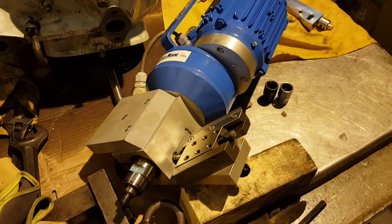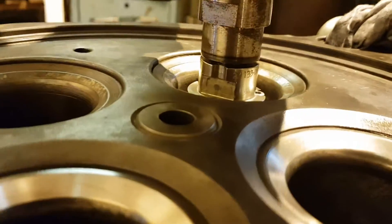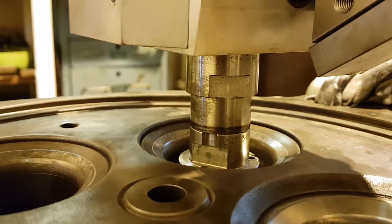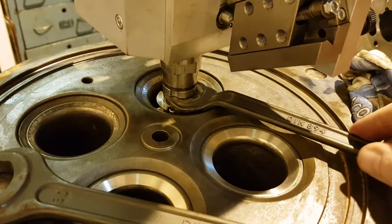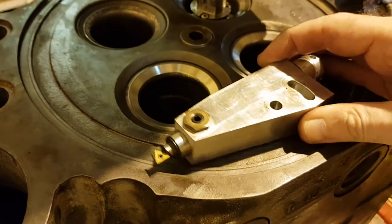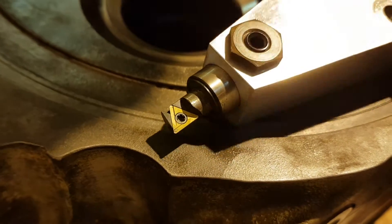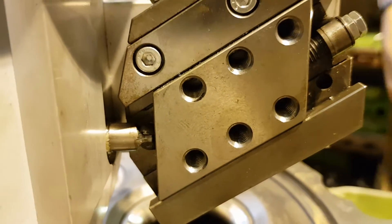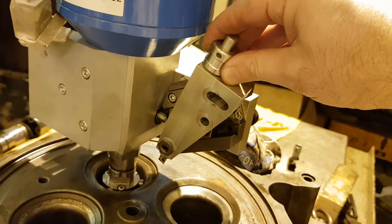This is the most expensive part — this is the heart of the machine. I am screwing the machine into the pilot spindle. By using two spanners and one hand, I am tightening them together. The machine has a tool holder bracket with a tiny turning bit in it. The slide moves between guides from the factory, pressed at an angle. After machining, the seat will be 119.7 degrees. By two screws, the tool holder attaches to the slide of the angle guide.